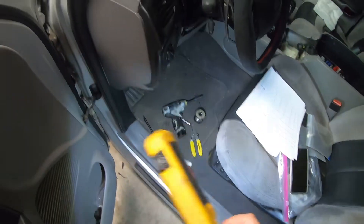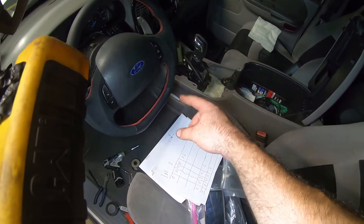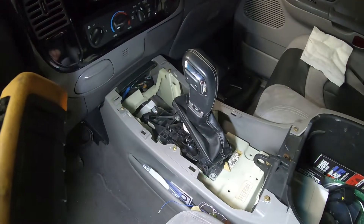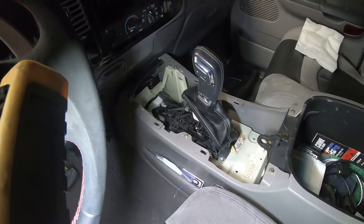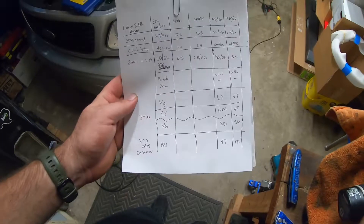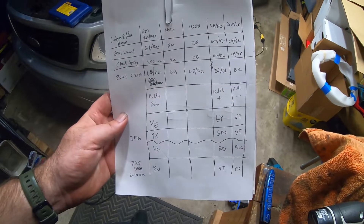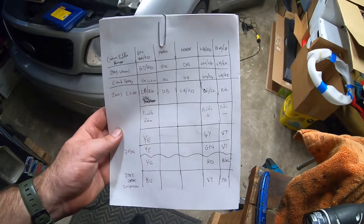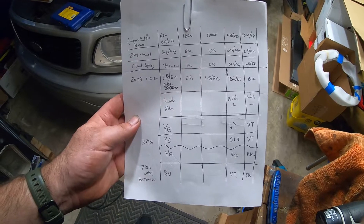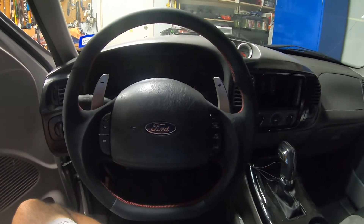Last but not least I need to clean up, put away all the tools, diagrams, and extra heat shrink, then tuck the center console wiring back together. I had pulled some slack on my shifter harness for extra room to work under the dash, so I need to work that slack back over where it belongs. My chart is completely filled out — showing how many times the wiring changes colors from connector to connector, through the custom harness, clock spring, steering wheel, and back again. No big deal, right? That'll wrap up this build video and the wiring will be covered in the next one.